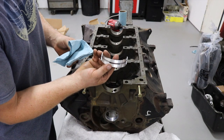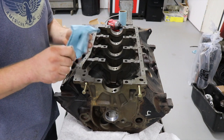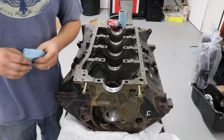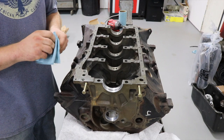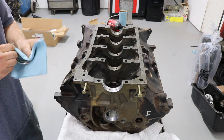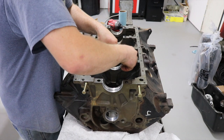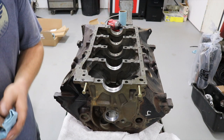Make sure you put the shells on the right side — this is the block-side shell, and there's obviously a slot for oil to go through. I already measured main bearing crush; this block is actually pretty straight, shockingly. Wipe them down, put them in, install all the shells, torque all the caps back on, then measure with the dial bore gauge. I do want this motor to be loose. I already had the crank polished to try and get a little bit more clearance. I'd really like at least three thousandths on the mains and at least two-and-a-half or even three on the rods.